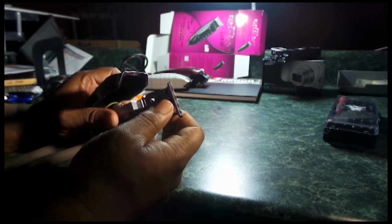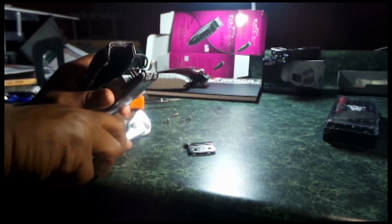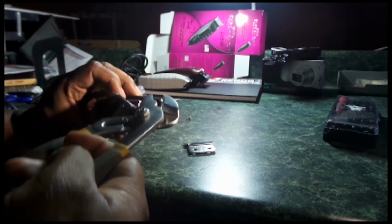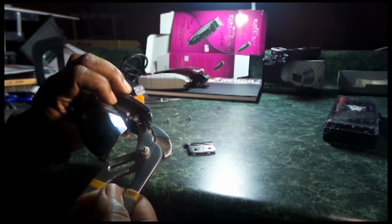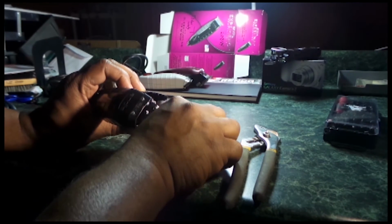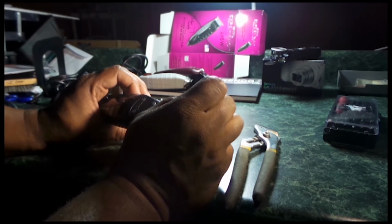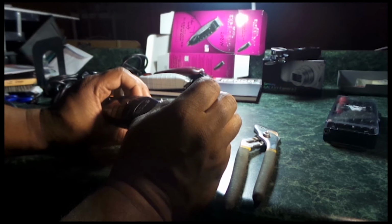Now, when I adjusted this at the shop, I took these pliers and I bent this back. I bent it more upwards. I grabbed a hold of that little ball joint and I went up on it. And what that did was put more tension on this moving blade, made it tighter. So when I cut it on, it barely moves. Matter of fact, it stopped moving.